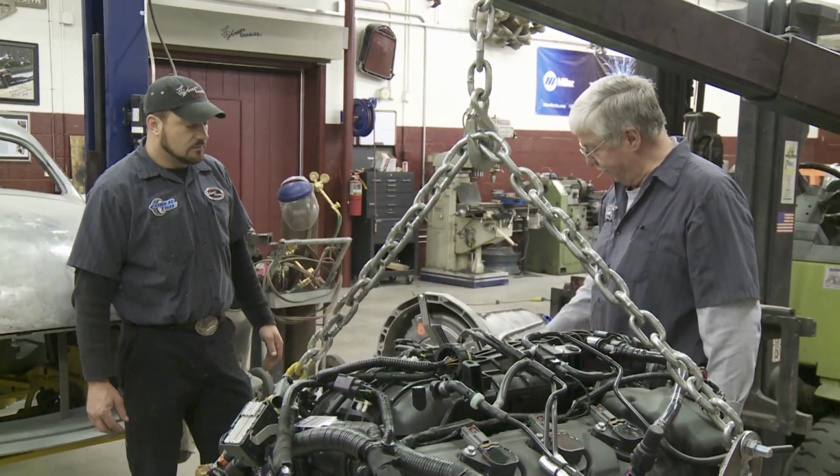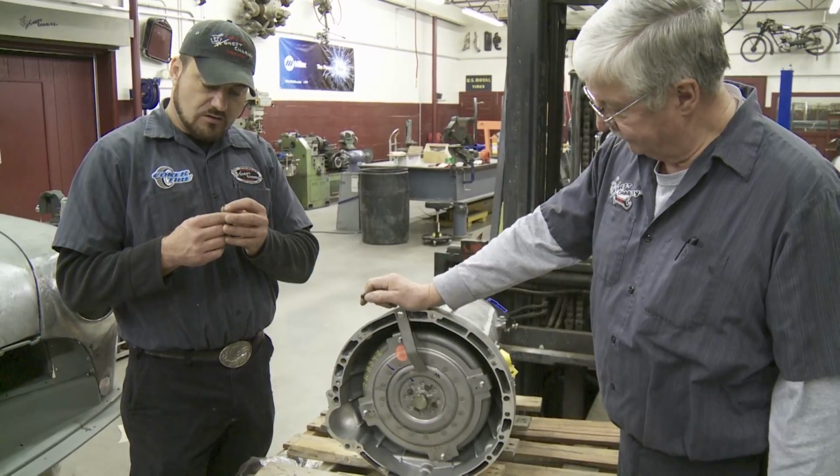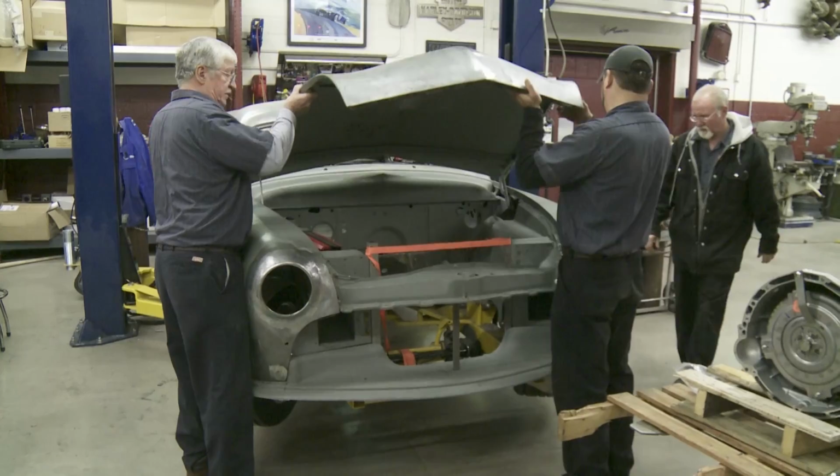First thing we gotta do is pull this front clip off this car, get the motor and transmission matched up, and then we gotta set it in because we're probably gonna have some issues with the front crossmember. The Fat Man set the frame up for a 350 and for a traditional street rod engine, and this is way off beat for traditional. So we got the firewall to deal with, the transmission tunnel, and fabbing everything up, motor mounts and all.